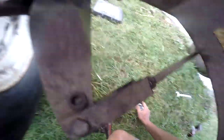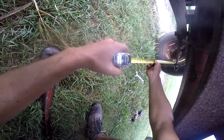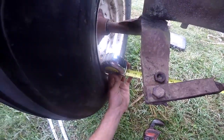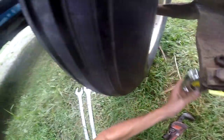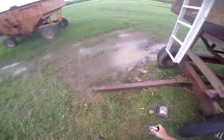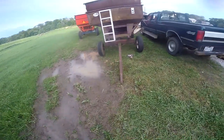Now let's see if I can do the back measurement by myself — this could be interesting, there's a lot of stuff in the way back here. We're hitting the rim and bouncing off a bit. We are 62 and 3 sixteenths. So we are a little less than a quarter inch together on the front — the toe-in is correct. Now the question is whether we have them set straight to the back, or at least they shouldn't wear crooked.